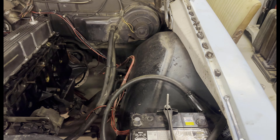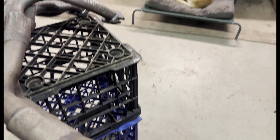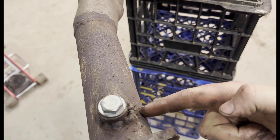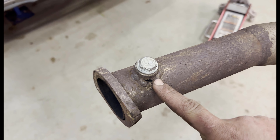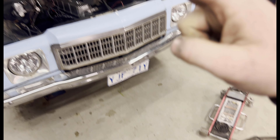Years ago when I actually had this motor built for me, I put a single carby on it and I wanted to put an O2 sensor in — this was purely for tuning. It is approximately 10 to 12 inches from the last merge point. Problem is, I was lazy enough to leave this in the car and never fully welded it. So I'm just going to quickly zap that up, clean it up, run a nice little bead over it with the TIG, and they can go back in the car.